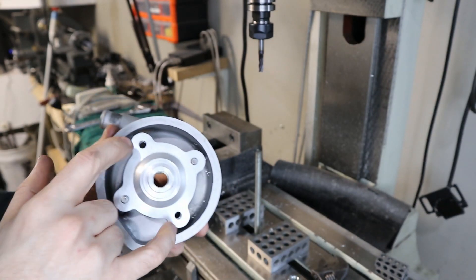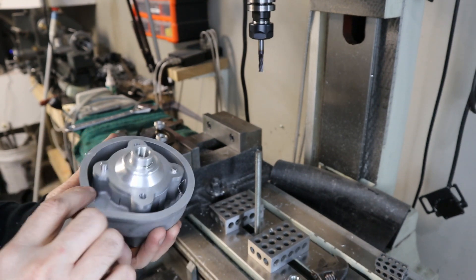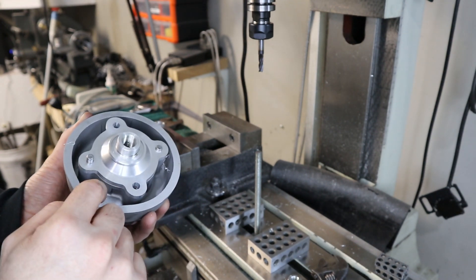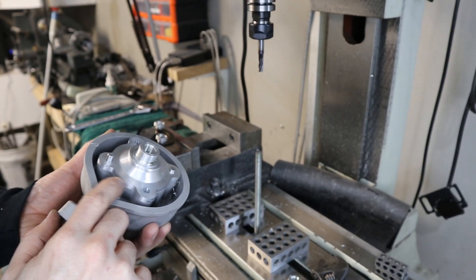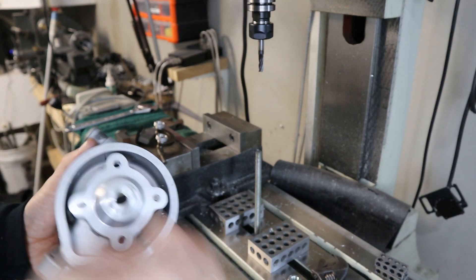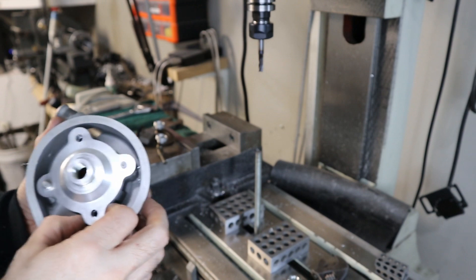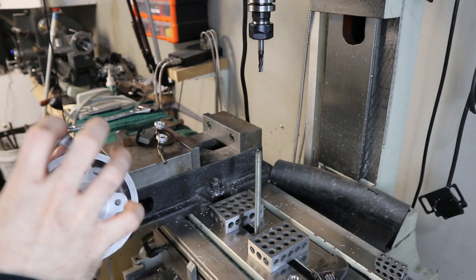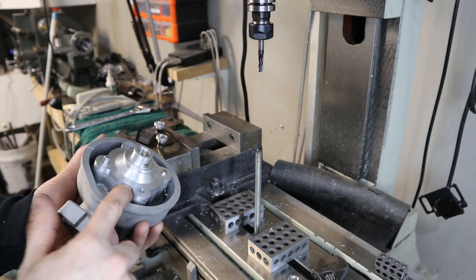So the cylinder is now ready to accept two hollow alignment dowels to hold the cylinder in position. I'd mark on this edge along here — write 'front' or something. Don't mark on the gasket surfaces, but that edge doesn't serve any purpose so you can write on it. Just so that when you're putting it on you know which direction to orient it — there might be a small difference between the two holes, so having it marked makes it easier.